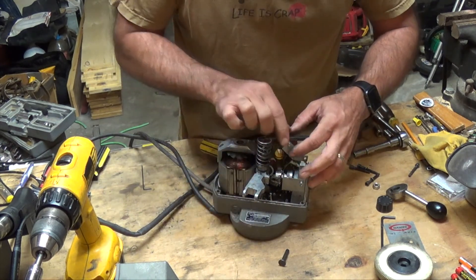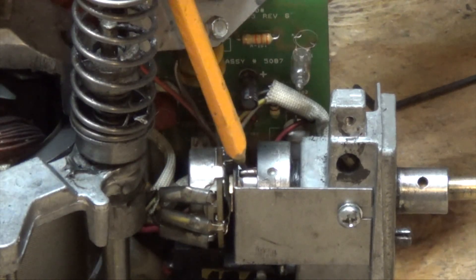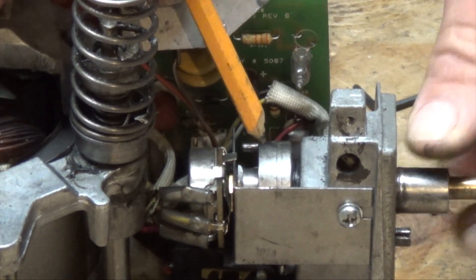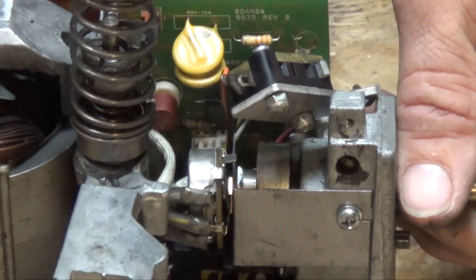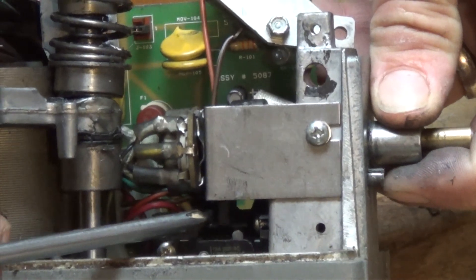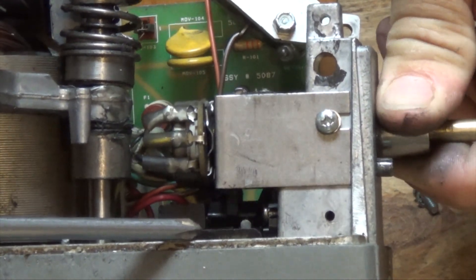Alright, there we go — let's get that out of the way. Now let's zoom in so you can see what I was talking about. Right here you can see the pin that's sticking out. As you turn it, that pin is supposed to be engaged in that switch at the bottom, but instead it can just freely go wherever it wants. So we need to get it back in that switch. What we've got to do is turn this all the way to the bottom and then make sure it engages in the switch. There we go — now you can see as we turn it back and forth it actuates both sides of the switch. That's the way it's supposed to be.